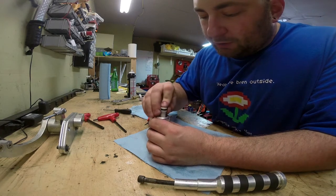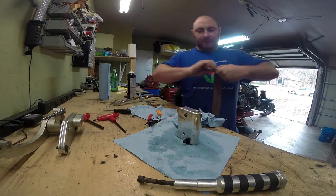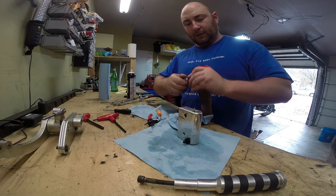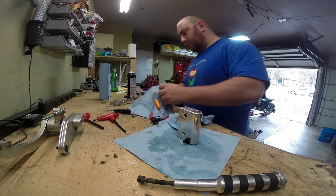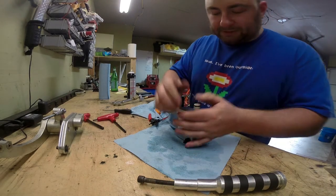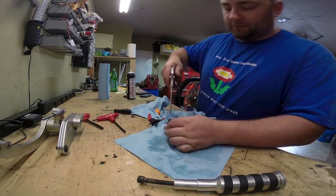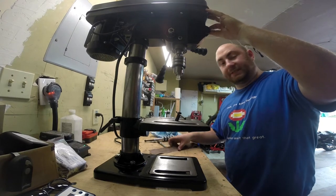This almost feels like it's the wrong diameter. What I'm doing here is taking a piece of fine sandpaper and sanding the outside edges of this down just a little bit to help clear it, because I think that's the issue. Whoever assembled this originally either used the wrong part or something wasn't quite right — because when you push down it just can't spring back. Ideally you'd do something like this in a lathe, but since I don't have a lathe...